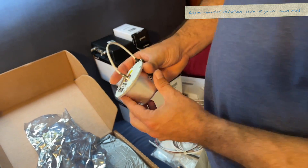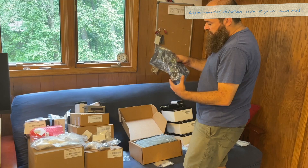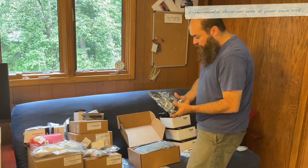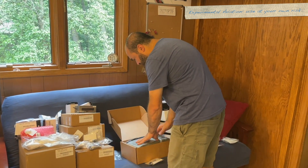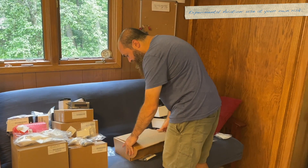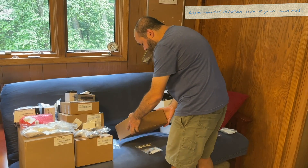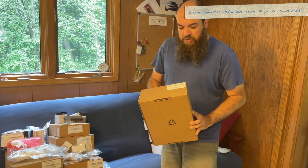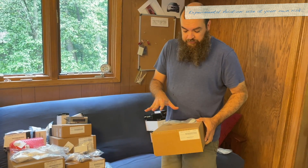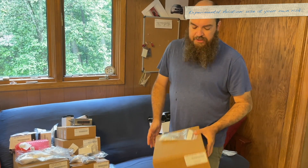We've decided to use the GMU 22 in our aircraft instead of the GMU 11 because of the CAN bus lengths on the RV-10 — they can be a little restrictive. There's a length limit for the CAN bus that Garmin has tested and is comfortable with. Because of the wingspan on the RV-10 and where all the servos are, you end up with really long CAN lengths. One of the suggestions is to use a GMU 22 because it doesn't go on the CAN — it uses a serial connection to the GSU 25, the ADAHRS unit. That way you're not extending your CAN possibly past the limit.